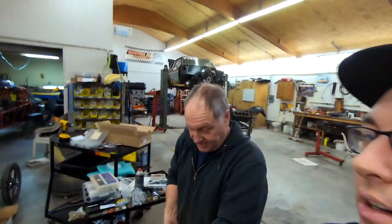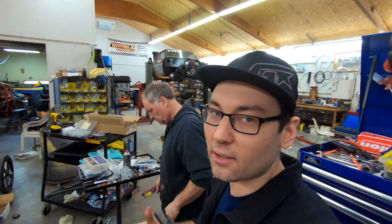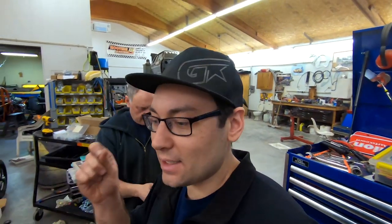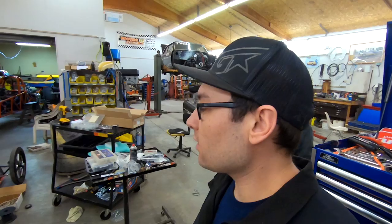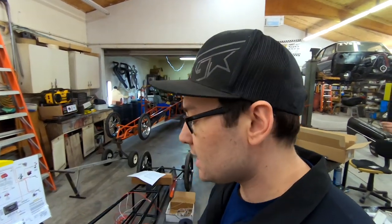One of the best parts about this, can't say this about too many things you do nowadays, it all seems like really quality stuff to work with. I'm not mad because threads are bad or ends are weak, right? It's quality pieces. Yeah, the wire is very, very flexible. It's got MTW wire. You're not going to find any THHN wire or anything like that. It's very flexible, easy to use, easy to strip wire. You aren't going to be beating up your hands or anything like that. You can lay it out real nice, make 90 degree corners very, very easily.